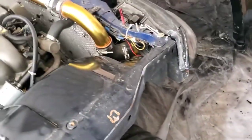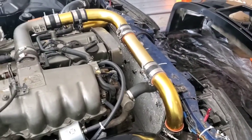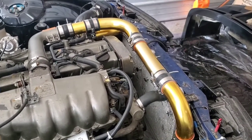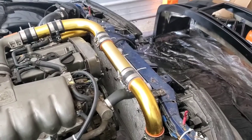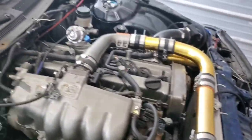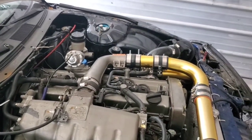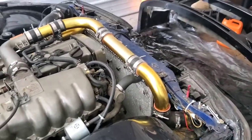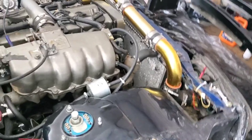Outside of that, I'm going to re-drain the coolant and try to get the overheating solved. I think it just needs coolant flushes because it doesn't leak or anything. If it's not the coolant flush, I'll replace the thermostat — I was told it was replaced and the thermostat does have a brand new gasket around it. Once I can get this thing to not overheat at normal operating temperature, it gives me more of a reason to drive it.